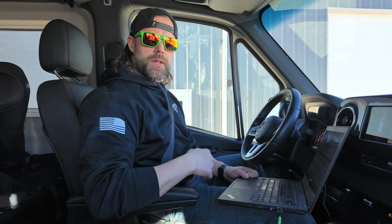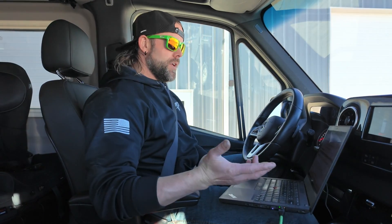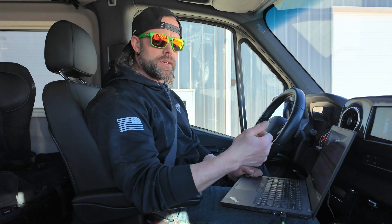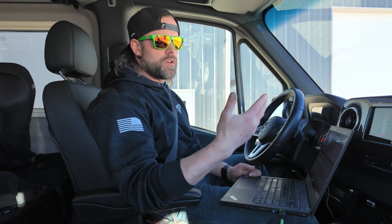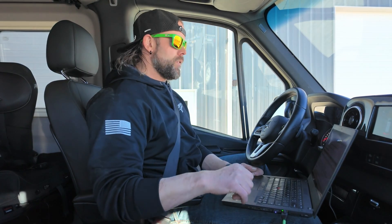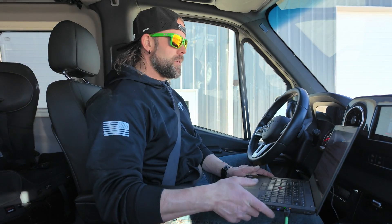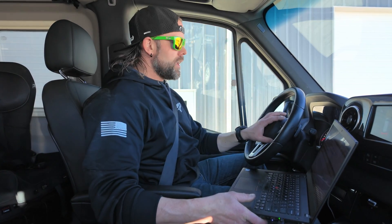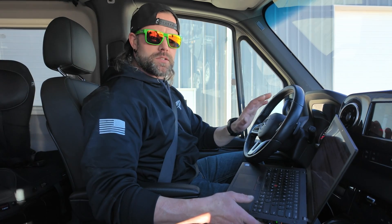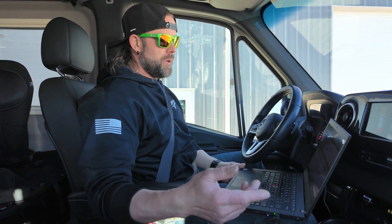It doesn't need to be fast — it's a relatively slow speed. We'll go on the highway into town and I've got a typical route that I run. Usually we have it calibrated by the time we get back to the shop. You do have to go through this procedure if you move the sensor outside the parameters: the van will compensate for plus or minus three degrees horizontally and plus or minus three degrees vertically. Outside that window, the van is going to be very unhappy, giving you errors on the dash.